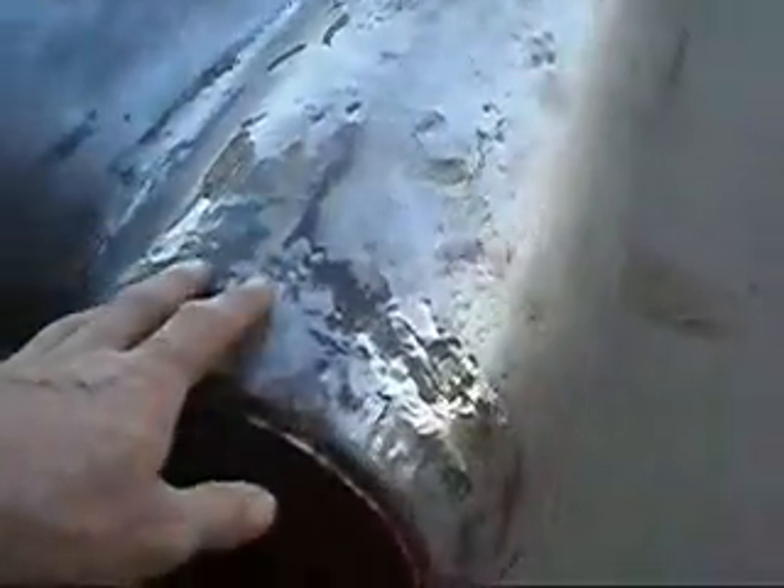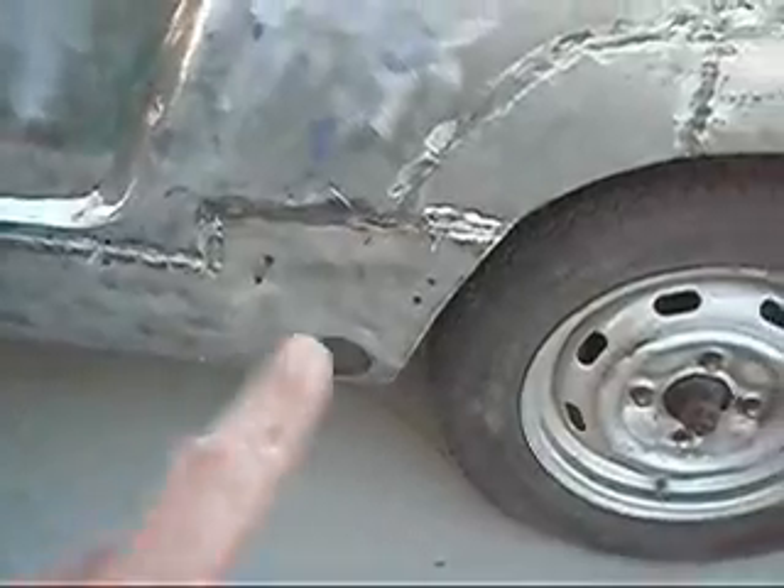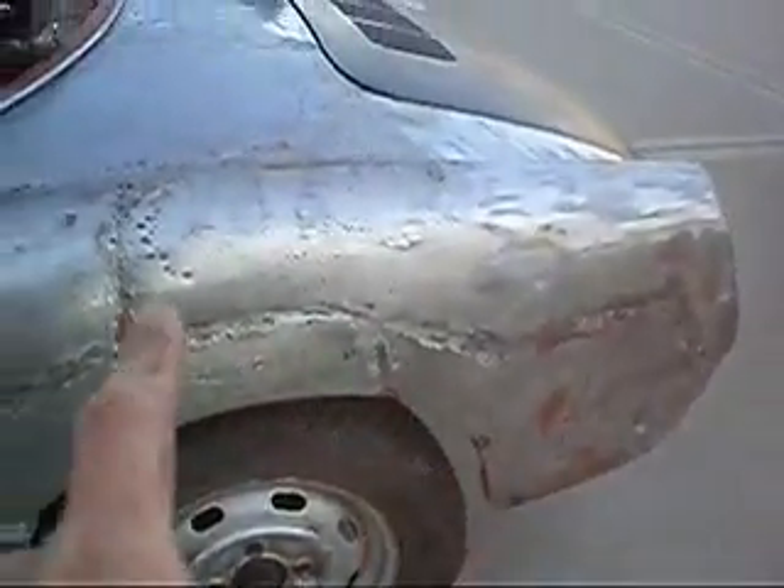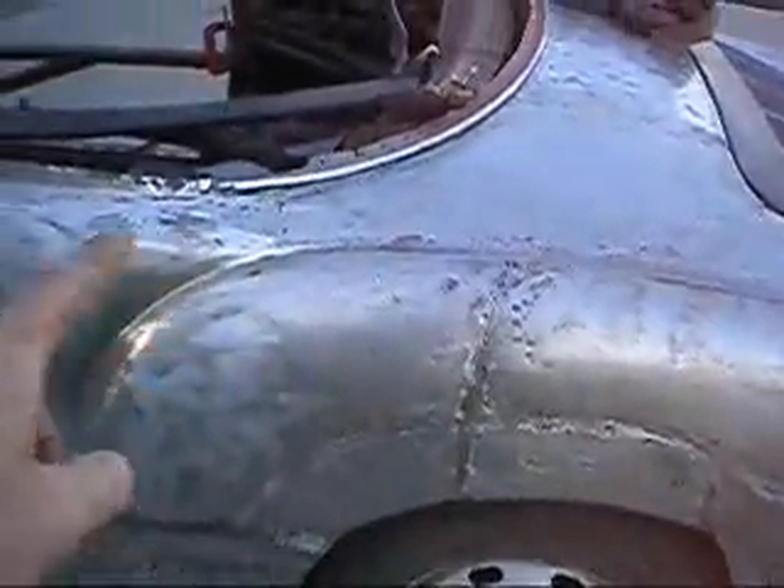A patch here that you can actually see — that was bad. A patch here. Welded in a new apron underneath. Welded in a new headlight. Skin and bucket on this side. Fender patch here. Rocker, heater channel, convertible stiffener. Quarter panel — outer, inner, wheel arch. Cut this piece, cut this off, and recut some of the welds here and redid them. They were horrible.